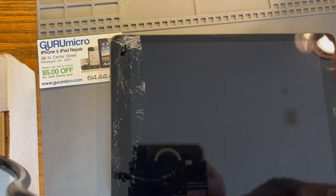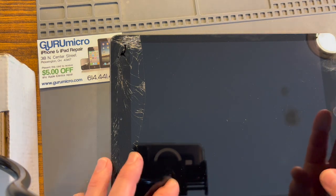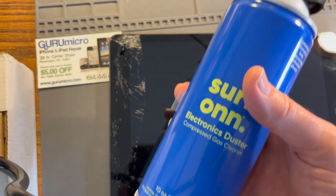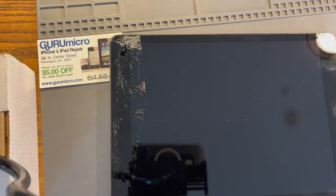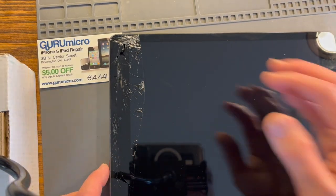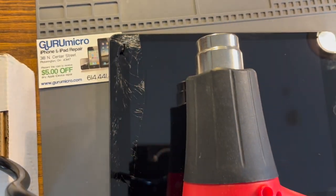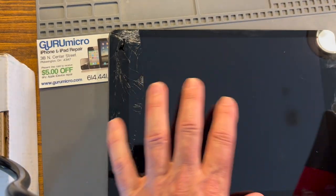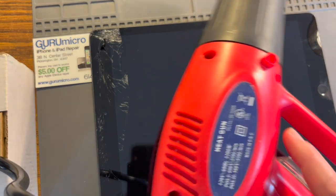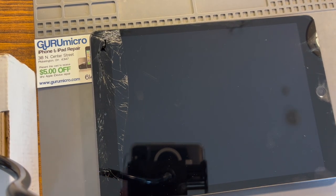The other thing I keep around is 91% isopropyl. I like it in a spray bottle — it makes it easy to apply. I apply it to my tools. And then compressed air, which you're going to need on reassembly in particular to make sure under the glass and the LCD is spotless and dust free, just like it is when it comes from the factory. And finally, and most importantly, you're going to need a heat gun or a heating pad of some sort to work this glass. I just use a regular heat gun. You could even use a hairdryer on high setting — it would be plenty hot to actually soften up the adhesive.